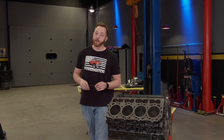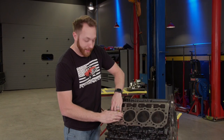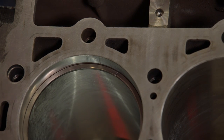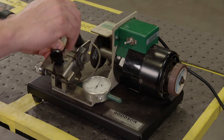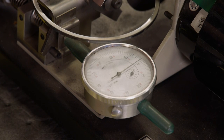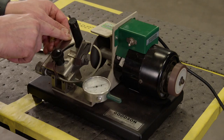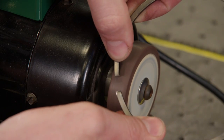Just about every piston kit you buy will come with a set of rings that require some fine-tuning on the gap. Depending on your application — whether it's naturally aspirated or forced induction, or even whether the engine runs on gas or diesel — that gap will be different, so they leave you enough room to work with them all. For this application we're looking for about twenty-four thousandths of an inch, and right now it's much too tight. There are many tools you could use — a whetstone, a diamond sharpening card, or sandpaper — but it is much more efficient to use a dedicated grinder. Ours has a fixture the ring clamps into and uses a dial indicator, allowing you to quickly and accurately dial in the gap. Take it slow, don't try to nail it the first time — sneak up on the finished size. Also remember the top and second ring have different specs.